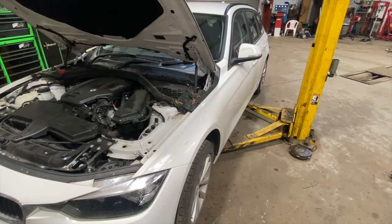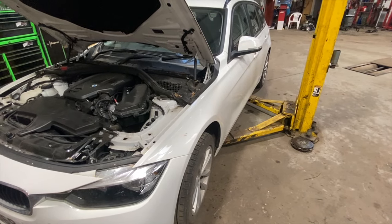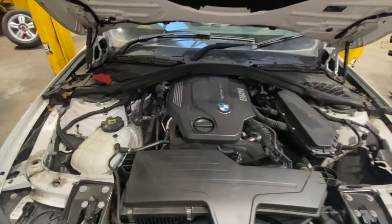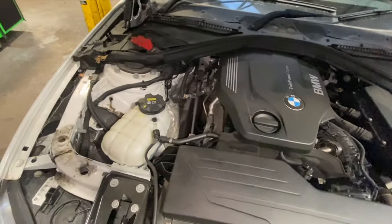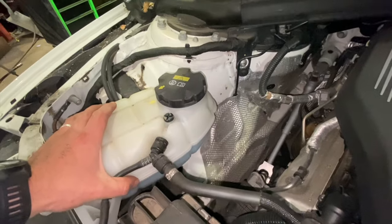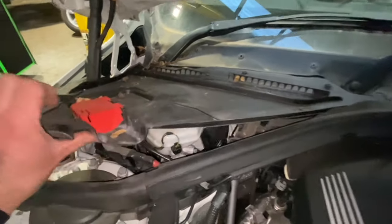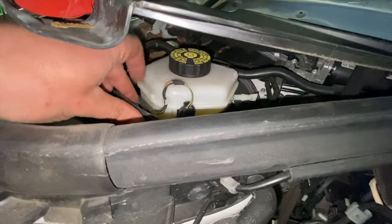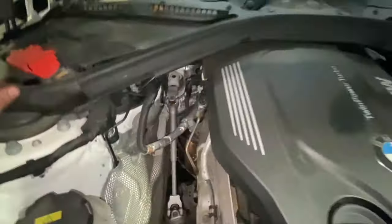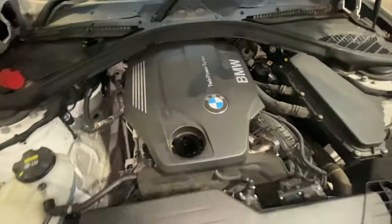We're using a two-poster ramp today — it does make the job a little bit easier. If you haven't got a ramp and you're just using a jack and a couple of axle stands, just jack it up nice and high so you can get access underneath. Coming under the engine bay, there are a few basic checks: your coolant there — just make sure it's sat between the min and max. You've got your screen washer cap to top up, and under this trim here you've got the brake fluid reservoir — again, check that it's between the min and max. The first thing we're going to do is take the oil cap off. This model's got the electronic dipstick so you have to read the level on the dash.